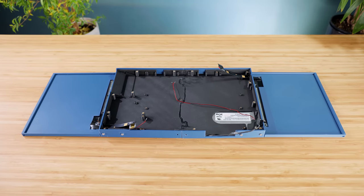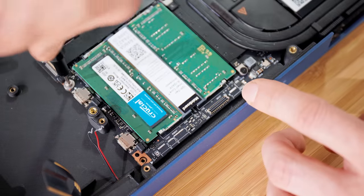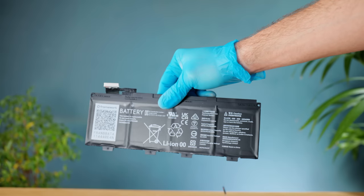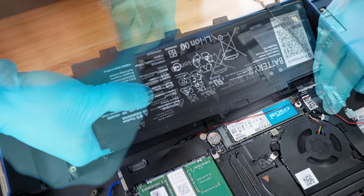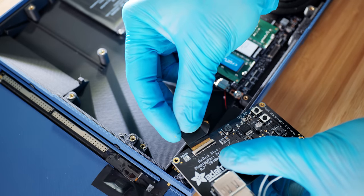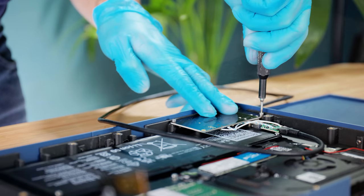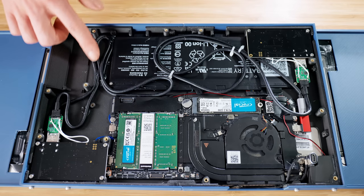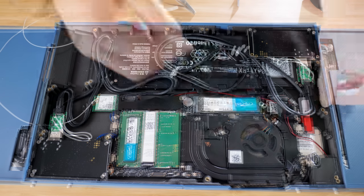Now this is where the fun can really begin, as it's time to add the various electronics, starting with the Framework mainboard, which can simply be screwed in place to the threaded inserts. There's a large gap left above this mainboard for a battery pack — a standard Framework battery from their website — which can just be plugged in and screwed in place. The display boards need to be plugged in at this point too, with the ribbon cables carefully tucked behind them. There's actually just enough space to keep the USB-C to DisplayPort adapter wires reasonably neat, and there's still room to add the Wi-Fi card and its antennas.